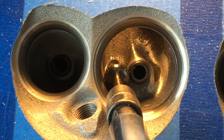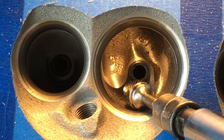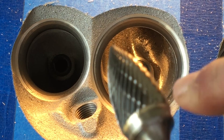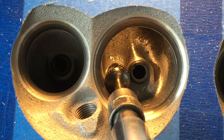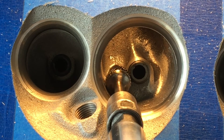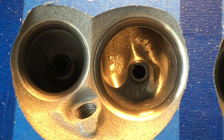Let your tool make that trough for you. As you bring it down closer to the area where it's going to blend into your back wall, you can start working it a little bit towards the outside. Keep in mind you can use the whole cutting burr surface as long as you're careful. Maintain your tool control and the angle of your cutting burr so that you can get that material removed and work with your landmarks to get that swirl ramp out of there and get it blended into the port without hurting anything or, God forbid, poking any holes.